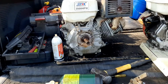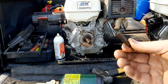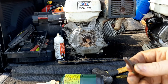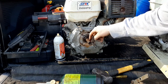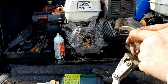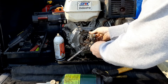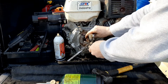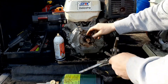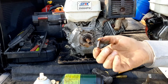And then with this one, you can see this keyway here — it's pretty rusted, part of it's broke off. So yeah, it was rusted in there. I did the same thing, it was in here like this, and then I just took the top edge of my pry tool here and went in like that, tried to hold it steady, like right here while I'm doing it, and it seemed to work. I coated everything with PB Blaster, kind of soaked everything — that kind of helped.